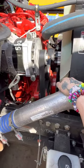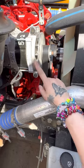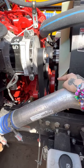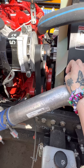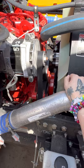So if the tester was standing next to me, I usually start with the water pump, then the alternator, then the belt. I would say: that is my water pump. It is securely mounted, not damaged, and working properly. No loose or missing nuts or bolts. It is belt-driven, and it is not leaking.